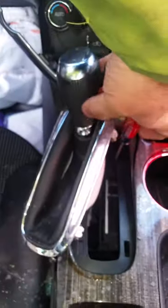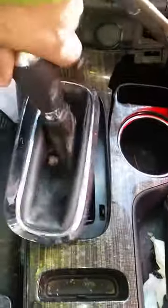You see that white little circle? What you're gonna do is pop a screwdriver right in there and push it down. Put the screwdriver in the hole and push down. Once you push down, you'll be able to squeeze the button and move the shifter. That's it — it's in park, but that's all you need to do.